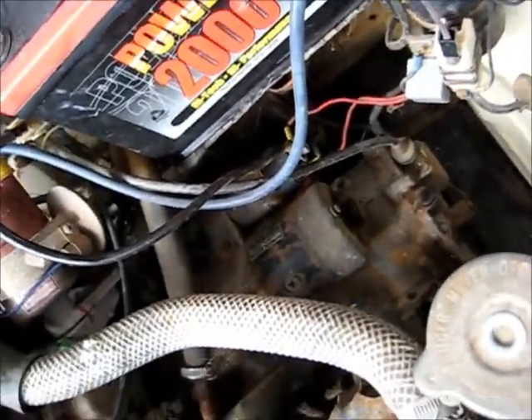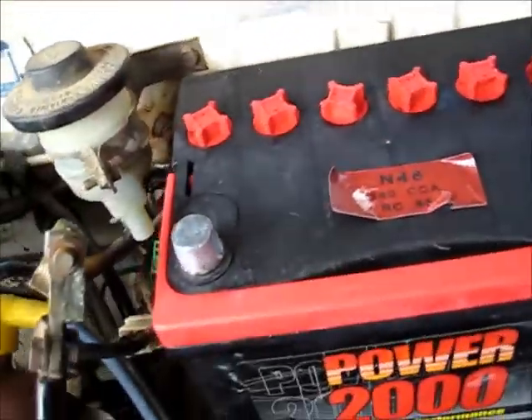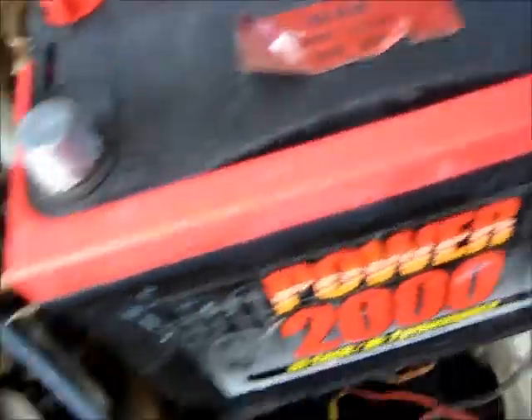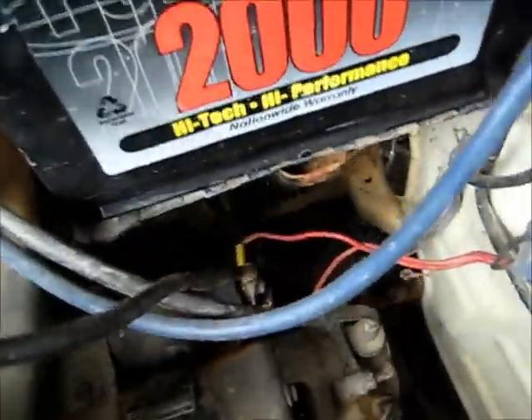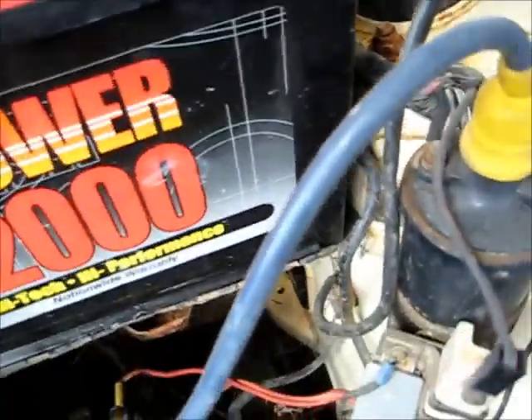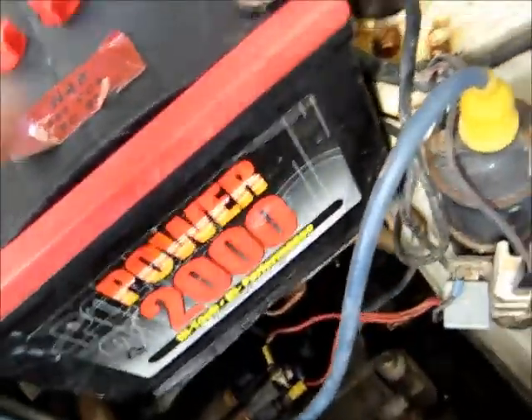This battery previously I just had it over there and I washed it with a little bit of sodium bicarbonate, because these cheaper batteries do tend to weep a lot. They're a nuisance when the terminals start to get all crudded up and your car won't start properly. I got an old toothbrush and just worked it into all the crevices where the water or the soda couldn't get to. It turned orange around this area because there was a strong concentration of acid around here, at this plate where the terminal post is soldered on. It's all clear now.